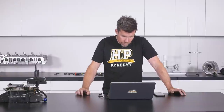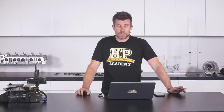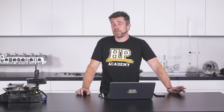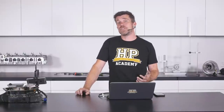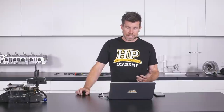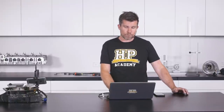Matty asks: can different oil filters cause different oil pressure? Quite potentially — there will be an oil pressure drop across the filter element, which varies by filter. What's important is that we measure oil pressure at the point where it enters the engine — that's what the engine is seeing. Always use a high-quality filter on a competition or performance engine.